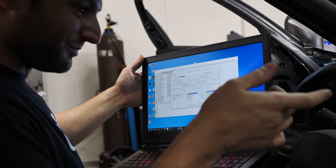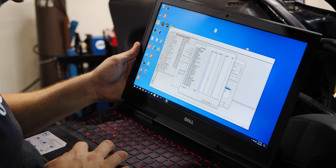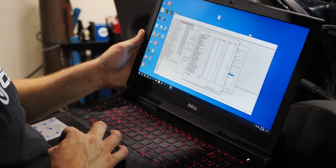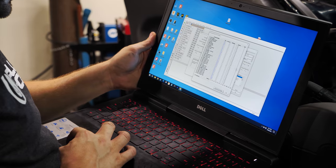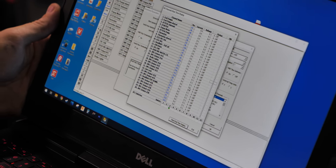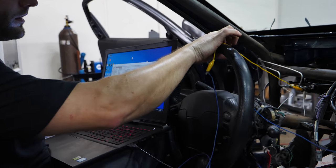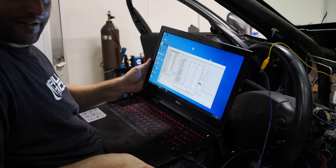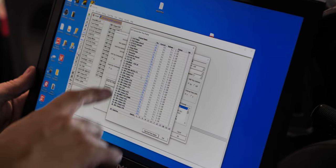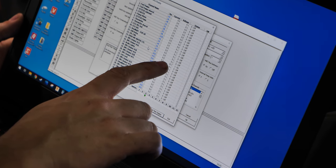The goal is to ground it out — the white wire is grounded and the yellow one goes to this — that'll be our simple circuit. We need to figure out which channel this blue wire is. The computer shows all the voltage and current on every channel. If I press this one right here, the tail lights will be blinking and doing cool stuff. The tail lights are on. I'll hit ground three — got a green light, pulled away, ground three got a green light. We can test this without even hitting the brake pedal. I'll press the pedal — and look, switch three turned on.